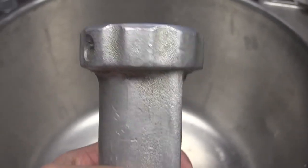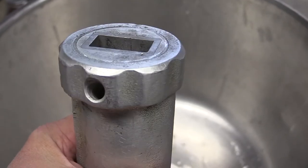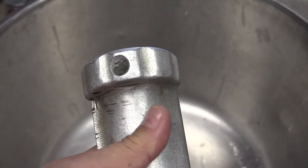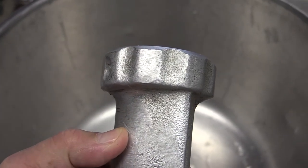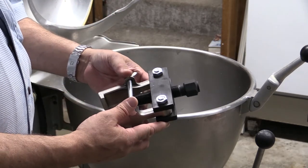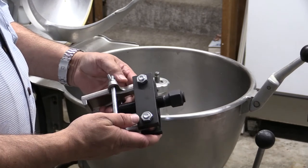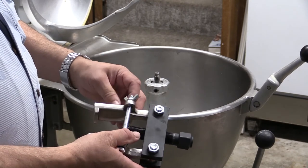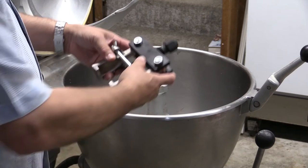If you look closely at the bottom of the cutter mixer attachment, it's tapered and not flat, so this gives the impression that you can't use a puller on it because it won't grip it. However, there is enough space — though you need one that has side clamps in order to keep the puller together so it will stay put while using it. I found on Amazon a robust industrial puller from Pitman with a three and a quarter inch spread that almost looks like it was made for this machine.